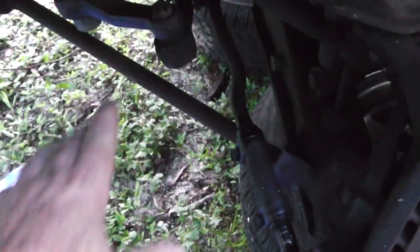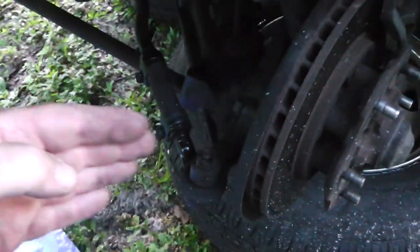Okay guys, I don't have to take this apart, but I do have to take this off, and I do have to take this off. The reason for that is I bought a new drag link assembly — or whatever it's called. So we're just going to pop this loose and pop this one loose, and I should be able to take it off, set it on a bench, kind of line it up, and make sure it's all the same size.